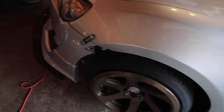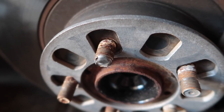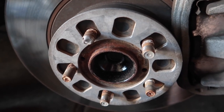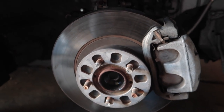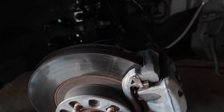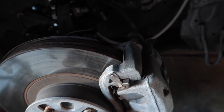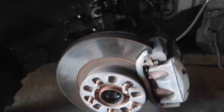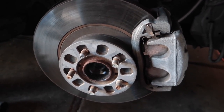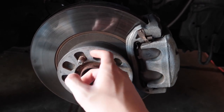The FRS is ready to be worked on — got the wheels off. What we're doing to this car is learning how to replace the stud, because as you can see this one right here basically snapped. What we're going to do is take off the caliper by removing the 17 millimeter bolts on the top and bottom on the back of the caliper.